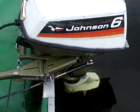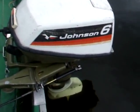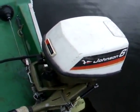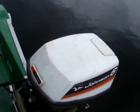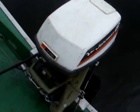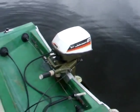In the past 3 years it hasn't been running because of the plugs, but since I did that redneck repair, it works fine, as you see. And like I said, I did some work on the carburetor, got that cleaned up. And also, I fiddled around with the ignition system. It's all been renewed. All new points, condensers, coils, and plugs. Well, the plugs are those ones I put in.